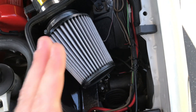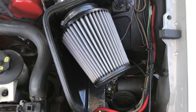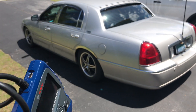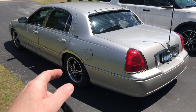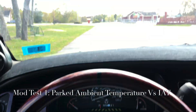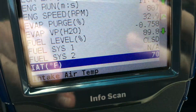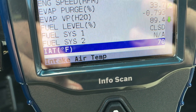I'm going to do the same test — 40 miles per hour and highway speeds — and see if there's any improvement. I'm going to take along the Bosch scan tool, let it get up to temperature, get some baseline readings at 40 miles per hour, and then do a highway run. The town car is up to temperature and we're just sitting idle here. Outside ambient air temperature is 55 degrees, and we have 70 at the intake with this mod.